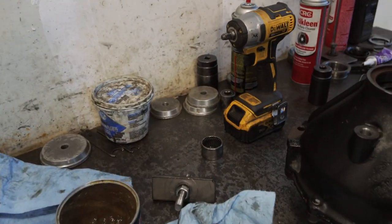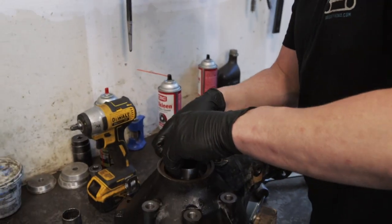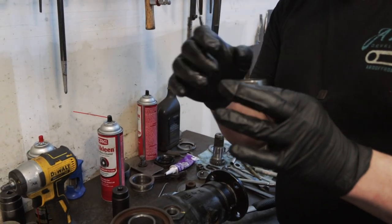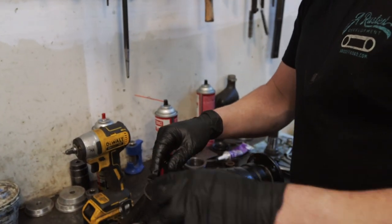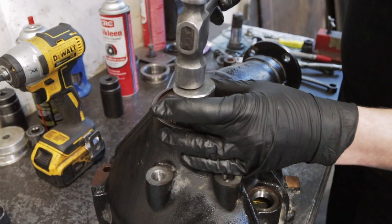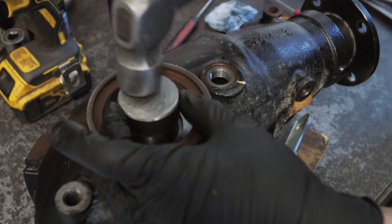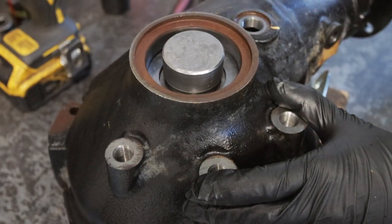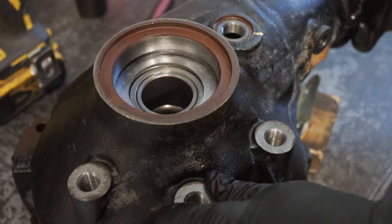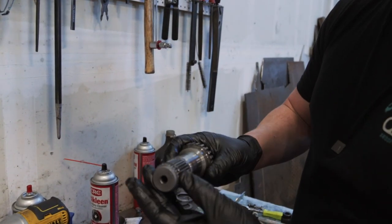These are significantly more difficult to remove than the others — you have very little room to grab a tool. It's a very thick housing; if it's stuck in there, it's not good. Now we just get that going, make sure it's straight. Perfect — and that's it: clamshell bushing installed.